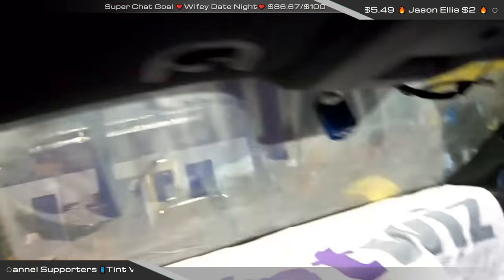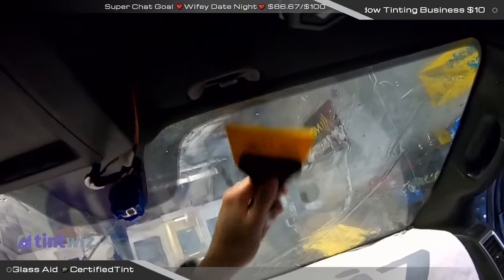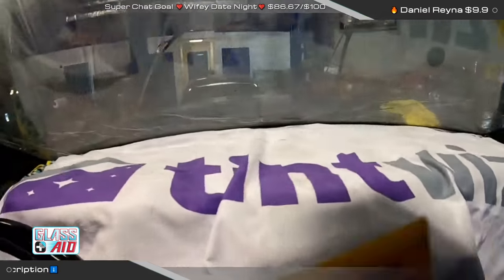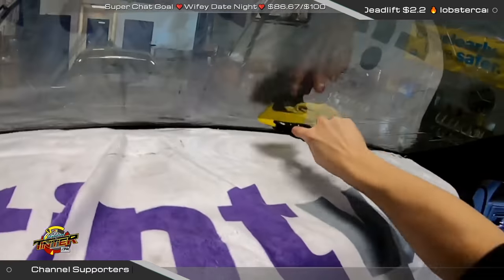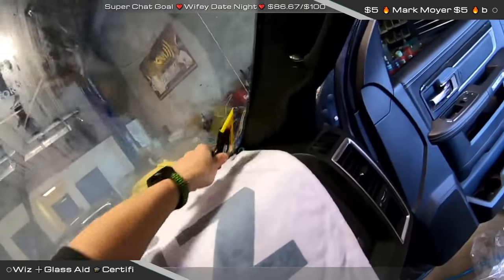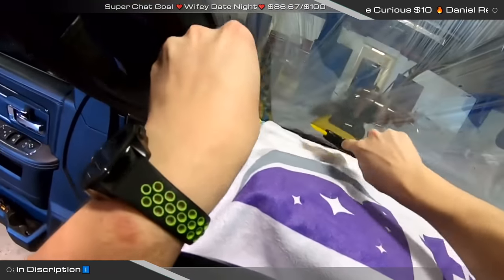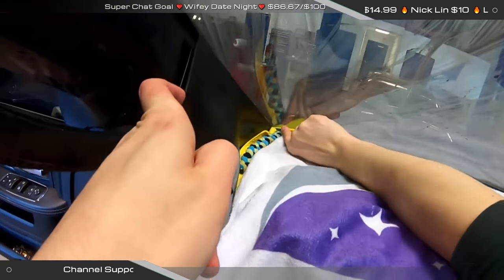We'll go live with some doors again and I can coach you through it a little bit better then too. Look at my 'how to tuck window tint' or 'tucking window film made easy' video — that's going to be the most helpful for you. A big part is just keeping everything even and smooth, because it's just one big sticker essentially. If you have a corner that didn't quite lay down and it starts knocking other stuff, it's going to peel back up. Also check out some other channels — Fade to Black, Window Tinting Business, Window Tinting Warriors. You got people helping in the chat — this is cool.